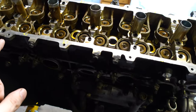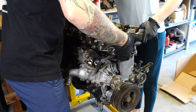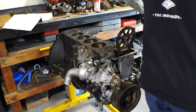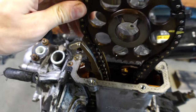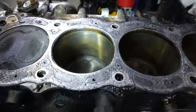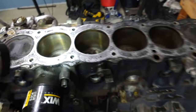We are ready to pull the cylinder head off this thing — it's completely loose. I'm going to grab Megan and lift this thing off the engine block. The cylinder head is off, and here's the cause for all of our problems — the broken timing chain slipper, as they call it, just a guide. One thing I wanted to show you: look how beautiful these cylinders look — they still have cross-hatching in them. No signs of any issues in those cylinders.